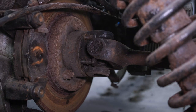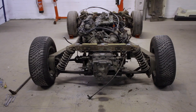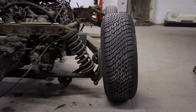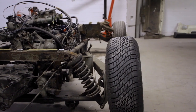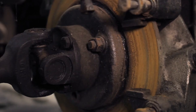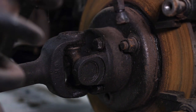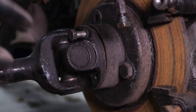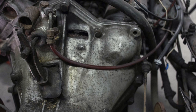Onto the drive shafts — four bolts, fairly standard stuff, and they dropped out. With that dropped out you can see straight away the droop in the wheel, and it's toeing out slightly now, as if you needed proof that the drive shaft was an upper link. The near side one didn't pose any more of a problem, but you notice there is a stud missing out of the brake rotor here. Probably wouldn't have been a big deal, but there's one thing I hate finding: where somebody's just not bothered to put something back.